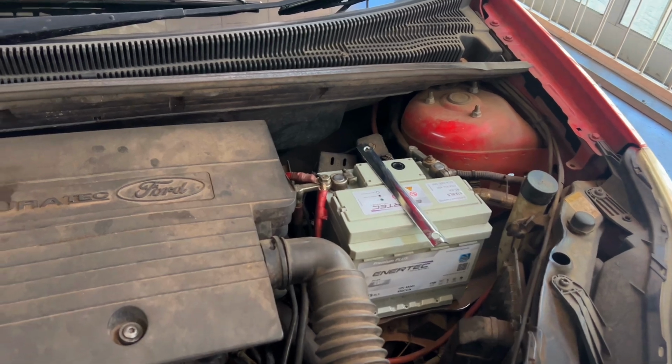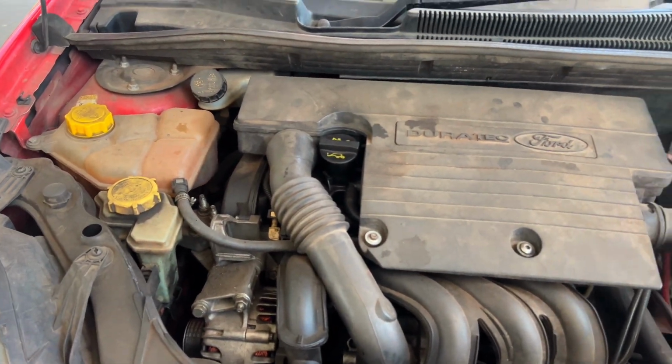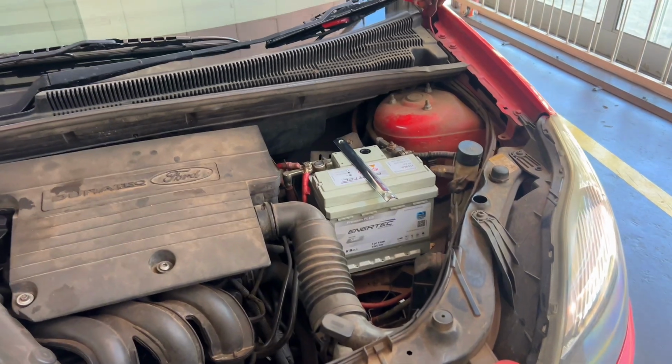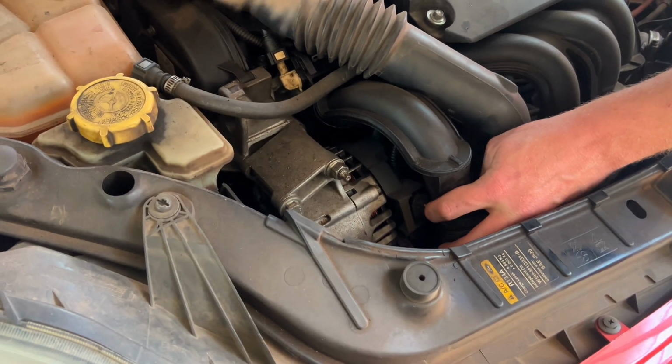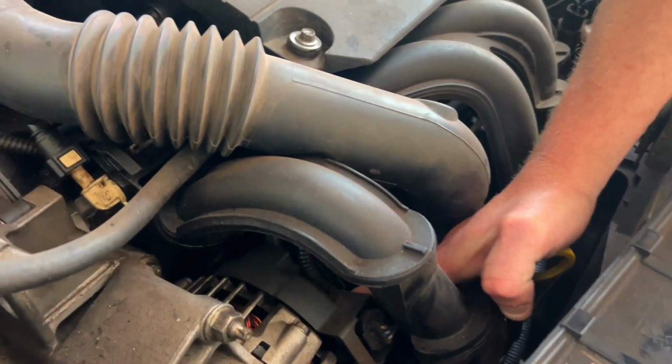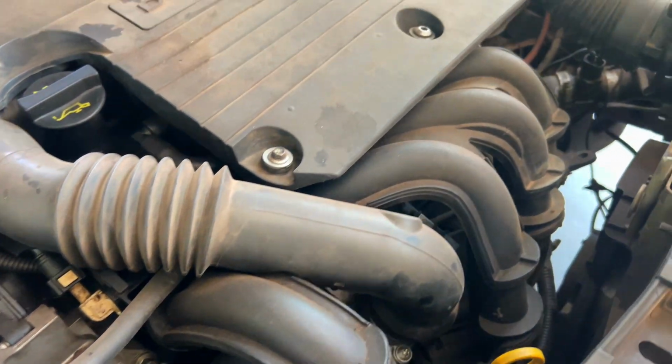Coming out, yeah. So that small wire that's running from the alternator to the back of the dash can be a connection error. Or that wire, sometimes it gets damaged on the inside. So then just follow it. Maybe just check from there and then rip apart the dash as well. Yeah, you have switches. Out of those 3 switches, you see there's 3 wires. So one of those 3 wires is running to the back, to the cluster.